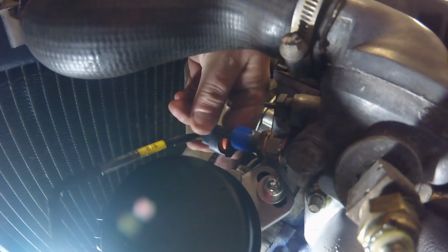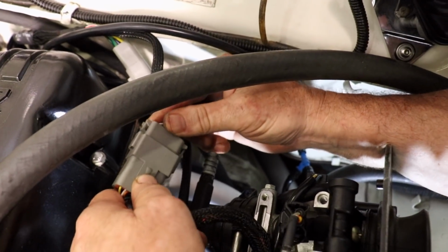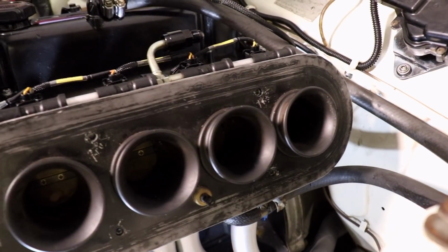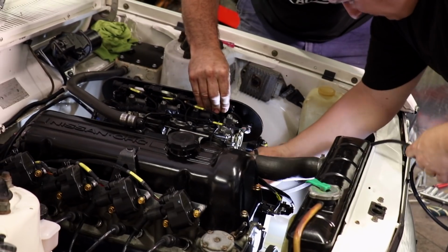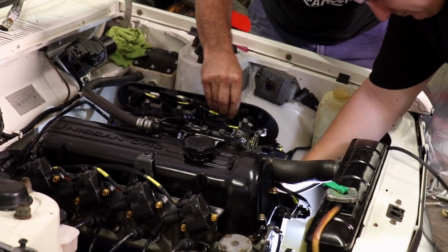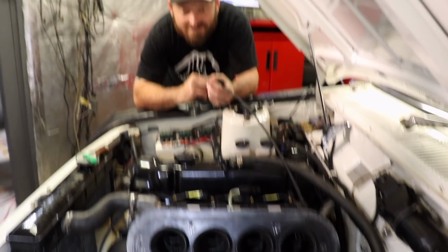A coolant temperature sensor is added so the Haltech ECU can see the coolant temp of the engine. In addition to the coolant temp sensor, there is also an air temperature sensor that is mounted on the throttle body plate. An air filter covers this, but for today, we're leaving it off. The accelerator cable is modified to suit, and Al makes sure it's going to do its job.